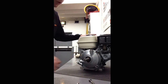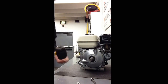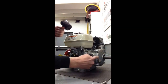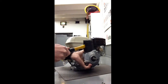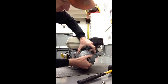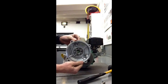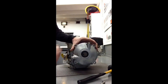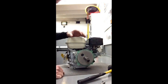Once those four bolts are out, I use a soft rubber mallet — you can use the palm of your hand if you like — and we're just going to gently tap on the outer edge here, just this piece, to knock this off. There we go. That is the outer cover. It will always be reinstalled with the arrow pointing up, oil level this way, and oil fill up. So you can set that off to the side for now and we'll come back to it later.